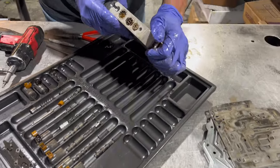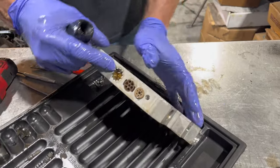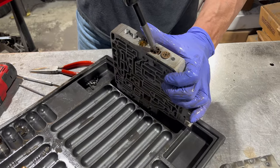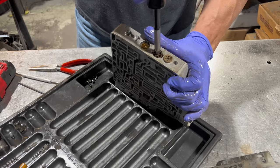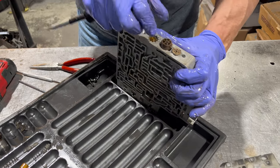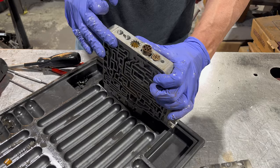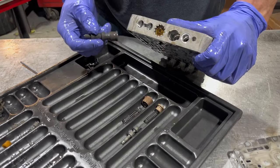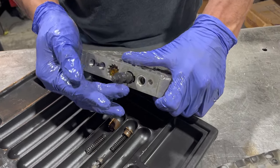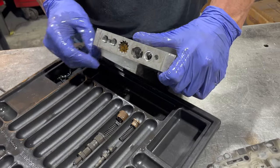Next we're on to the other side. We have several things here that we've got to take out, and I'll show you what we end up with again. This one is different than most of the others because it unscrews — these you kind of push down and give a little turn until they pop up. These are plastic, so when possible when they make metal replacements we change them. Now this is the pressure regulator valve. These things kind of wear to death in here, so we're going to have to re-bore that and put an oversized valve in.